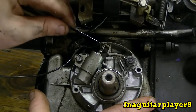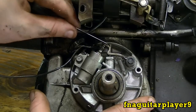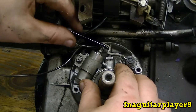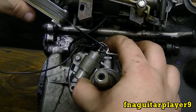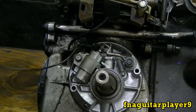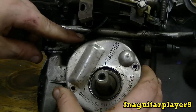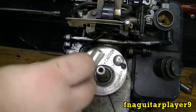The reason I showed setting the gap first is that usually you don't have to do this when setting up brand-new points. But when working on your engine, you always want to check your points gap, because you can take out a little too much metal. As you can see, it's actually a little loose in there now, so we need to adjust them again. Pull it till you get a little bit of drag on the feeler gauge, and tighten it back up. You can leave your feeler gauge in there and hold the tension while you tighten it. Don't get it too tight because it's just going into aluminum.